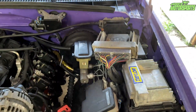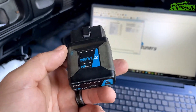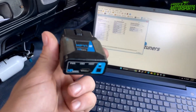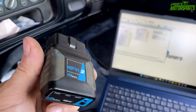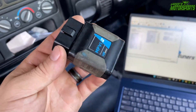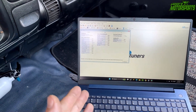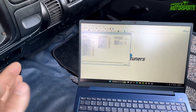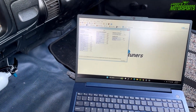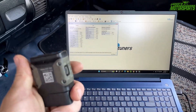If you ever have to switch to a different PCM you have to buy credits for that one. On Jacob's MPVI2, the tuner itself holds all the credits and he has unlimited use credits for the LS base engine from roughly 1999 to 2004. He can grab a PCM from the salvage yard, load a base map on it, and sell them at a profit. I can do something similar — buy six credits for $300 and unlock, say, all 2002 PCMs. It wouldn't work on 2001 or 2003, but all the 2002s it should work. It's definitely worth the money once you know how to use it.